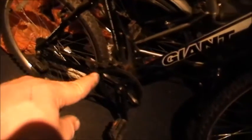I could fix this one up at the same time I do the Claude, actually. I've got a replacement front derailleur. Someone's jammed it in the top gear — they've done the adjustment screws all the way in, so it won't retract, that's why it's stuck up there with the cable flailing around. I'm going to put all new cables on it, probably new brake noodles. I've sort of started to give the frame a clean, at least on the underside — I just haven't done this side.